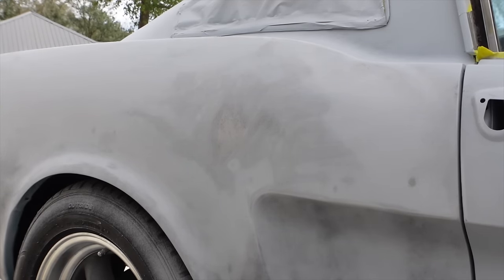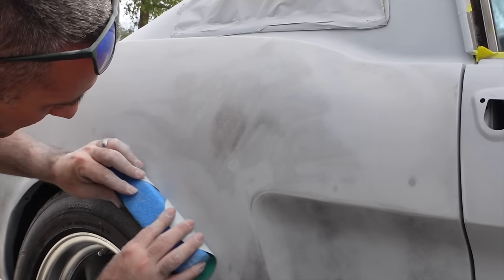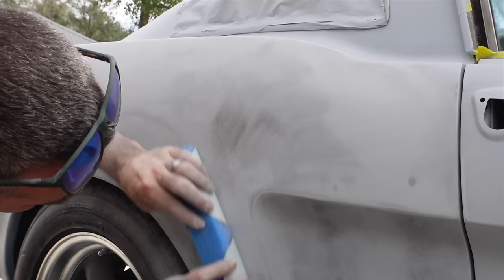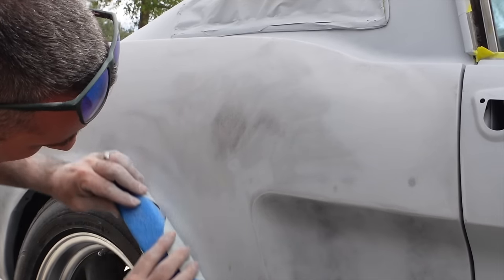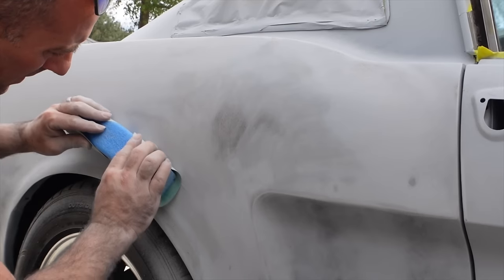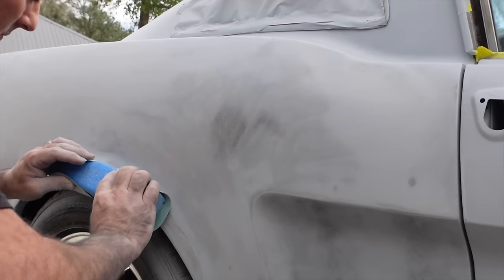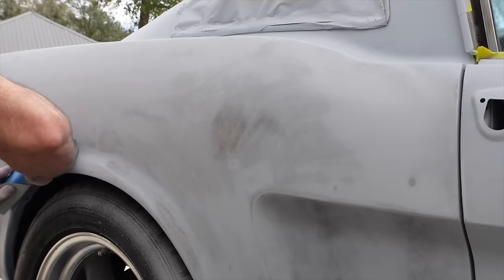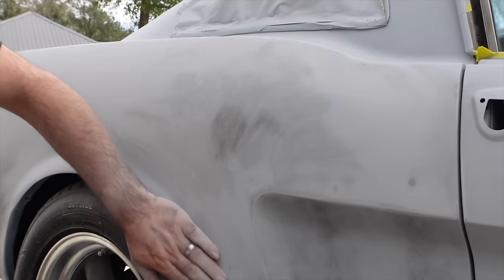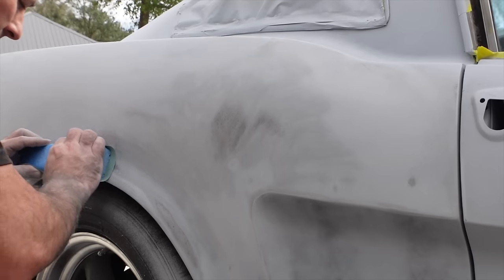I've swapped over to one of these soft sanders. What this is going to do is allow you to really push on the edges to conform to the body of the car. What's the difference between a soft sander and a hard block? If you have a flat panel there's really no point in using something flexible, but in a curved area I'm pushing on the edges and it really helps conform around what you're working on. It's not a necessity but it does help smooth things out, especially working with primer since primer dusts off so easy.